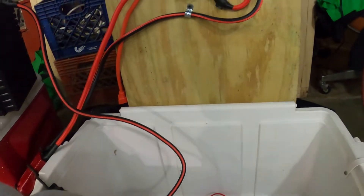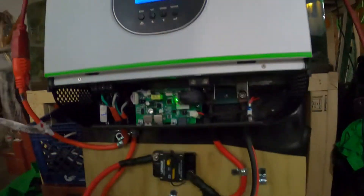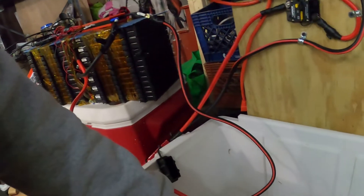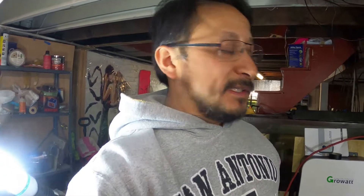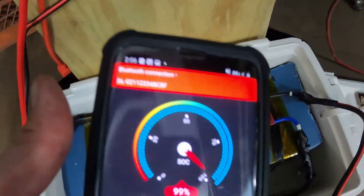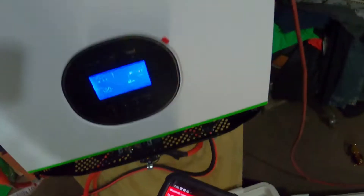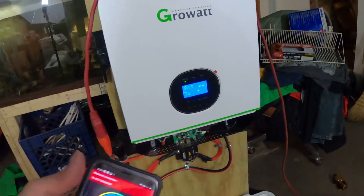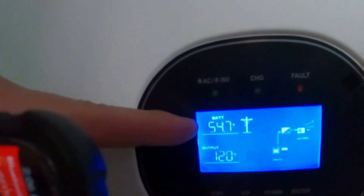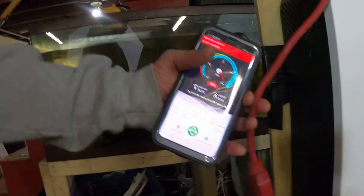I got to put the battery in here — that's why it was really light. Let me get this set up and put weight in here now because the battery is sitting right there. Okay, here we are — it's at home. That's a 48-volt LG Chem pack battery with a Daly BMS connected. The battery is at 54.8 volts, current at 0.06 amps, because it's running the Growatt system.